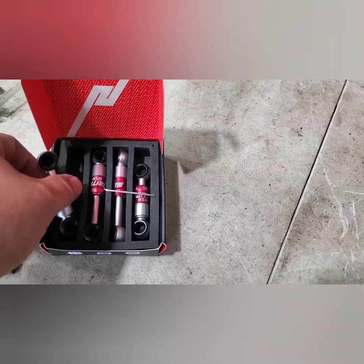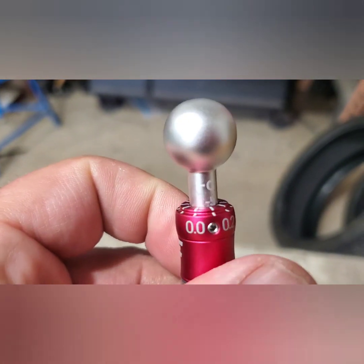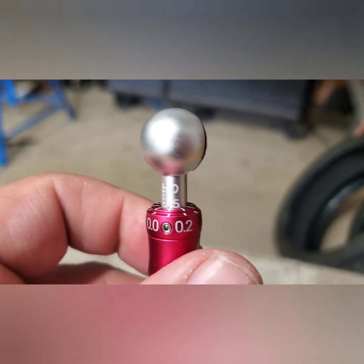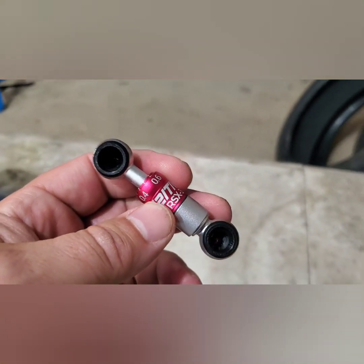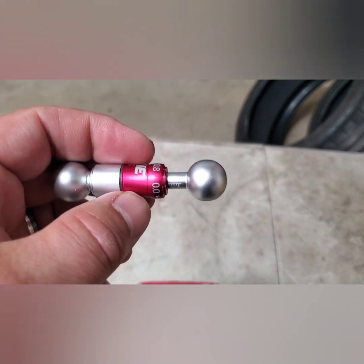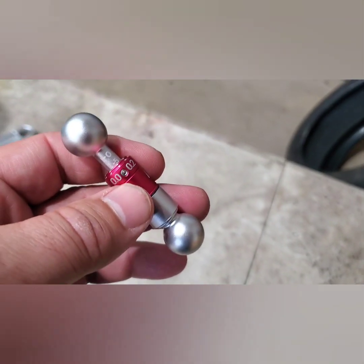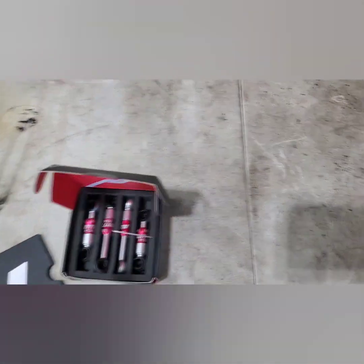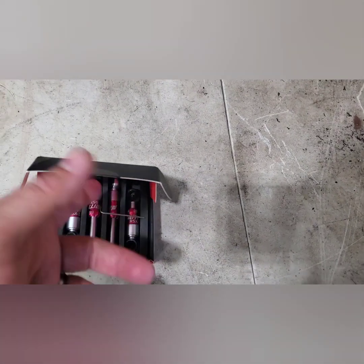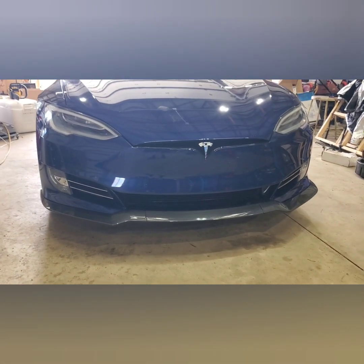These are the Intuitive Links I'm going to use. I already set them to five — I see some people set them at four, some at six; I'm just going to go right in the middle at five. We're going to see where that takes me. I didn't want to drop it super low, but we'll see what this does. If I'm three quarters of an inch to an inch I'll be happy with that, and if not you can just twist it one more turn to gain more.